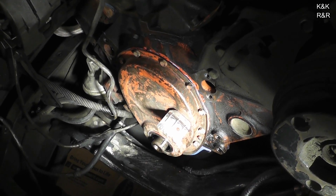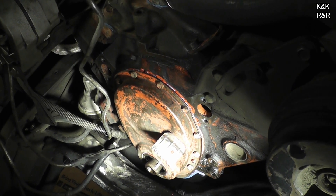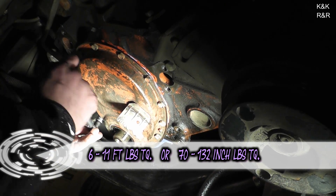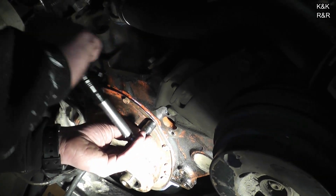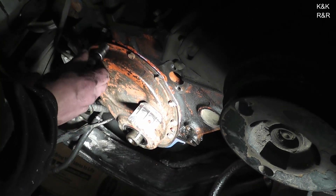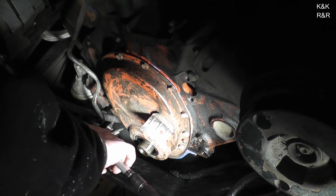At this point we're going to torque the timing cover — we've let the RTV set. This is my personal way of doing it; others may argue but I don't get oil leaks after I do these jobs. 7 foot-pounds — actually 6 foot-pounds, 70 inch-pounds. Some books vary; I've read anywhere from 6 to 11 pounds depending on if I'm reading a Chilton's or a Haynes. We're using our new inch-pound torque wrench. He's doing a criss-cross method using every-third-bolt pattern: start with one, skip one, go to the third, skip, go to the third. Then do your second pass — it makes for better sealing. That's from a GM Tech.